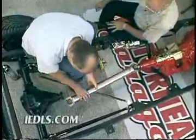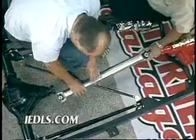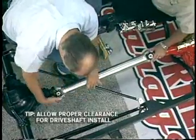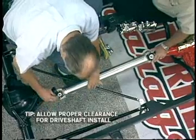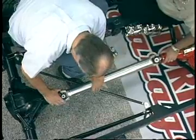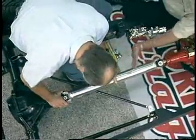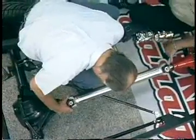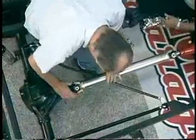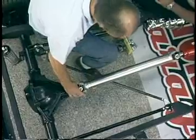Let's put this in here. One of the tips Greg gave me: when you slide this in, you need to have anywhere from just barely touching this yoke to about three-eighths of an inch of clearance. That will give you the proper movement. Because you're going to pull this back into the pinion yoke, and that's what gives clearance at the transmission end so that the suspension can move and the shaft can slide freely back and forth. We've got a nice fit on that.